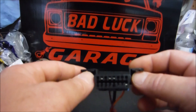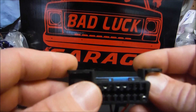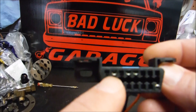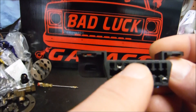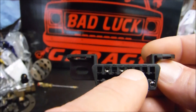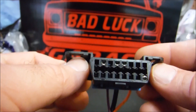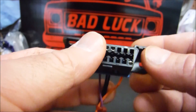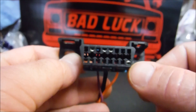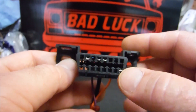When you're wiring your OBD2 port, all you're going to need — see if you can see in the connector here — you're going to need pin 2, which is your serial data line. You're going to need pins 4 and 5, which are both grounds. And then you're going to need pin 16, which goes to a 12-volt constant — just 12-volt battery.